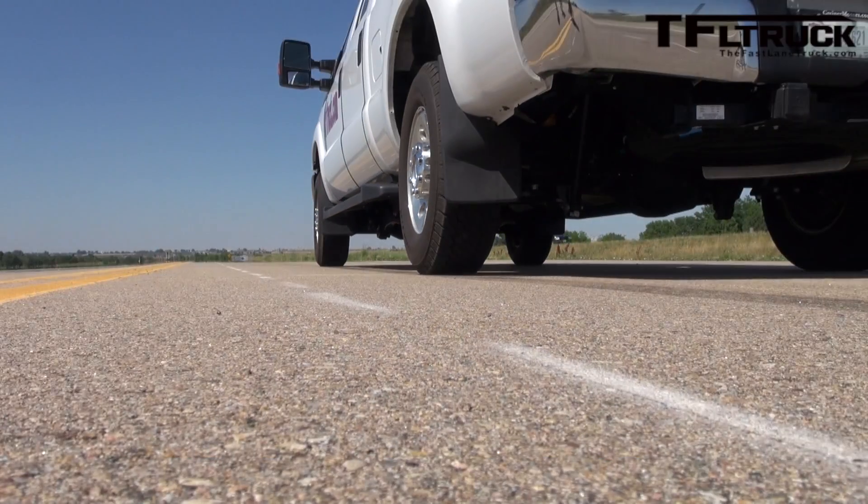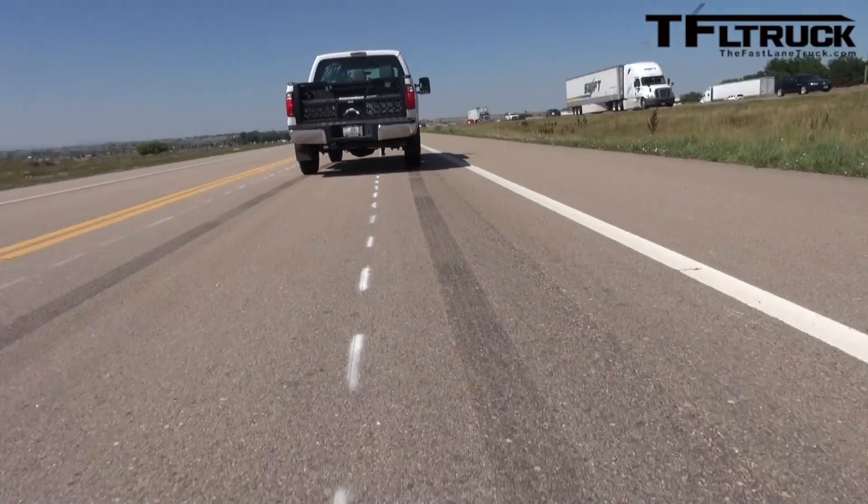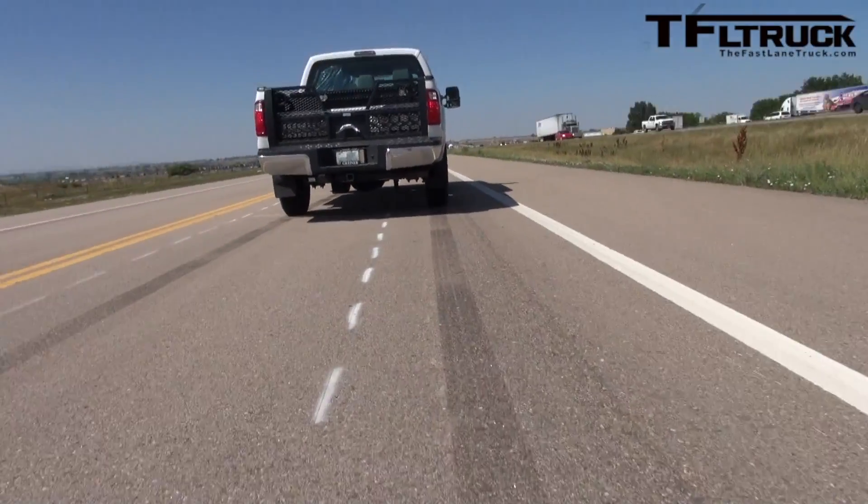There's something interesting — if you look closely you can see the dark striations in the skid mark. Basically what's happening is the ABS is pumping the brake, and the tire is releasing and grabbing, releasing and grabbing, to keep the wheels from locking up. ABS at work right there.